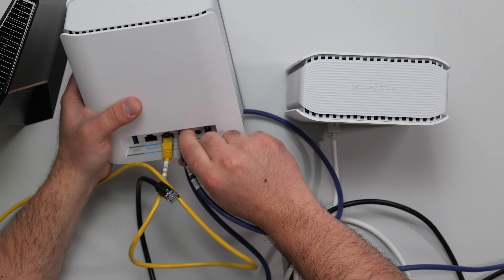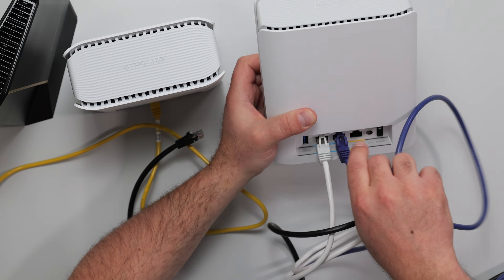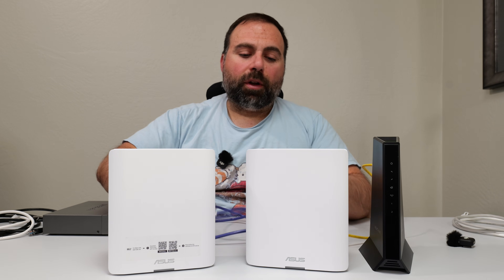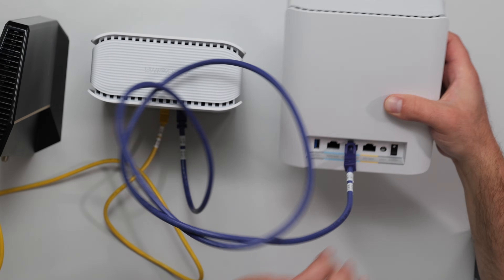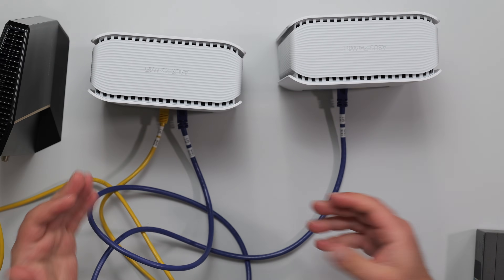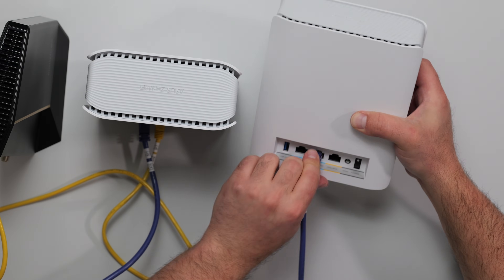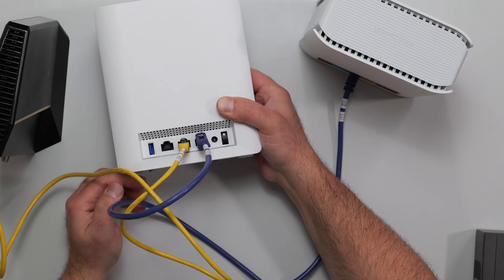The source going into the switch can even come from a wireless backhaul node — you can connect it to that node's port and it'll be fine. Now, for wired backhaul, it's very similar to wireless backhaul except there's an Ethernet cable going from one node to the other. You go from the 10-gig LAN port on the main node to the 10-gig WAN/LAN port on the secondary, and you've created a wired backhaul network, which is typically ideal. That's what I use at home. For gigabit internet, you can use the gigabit ports instead.